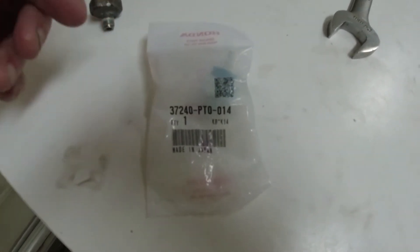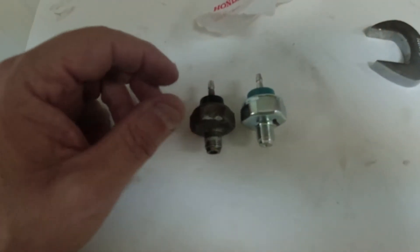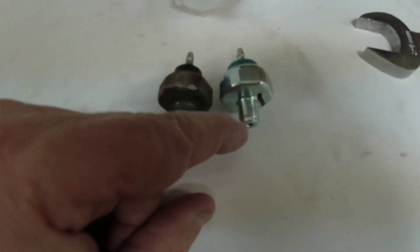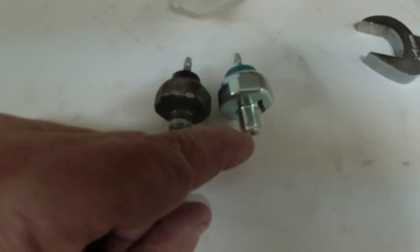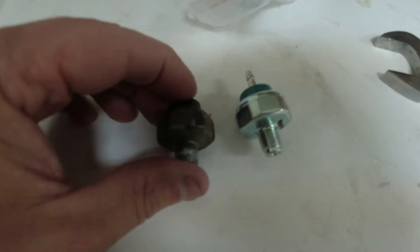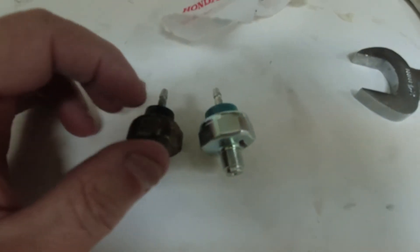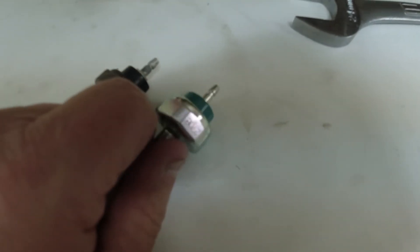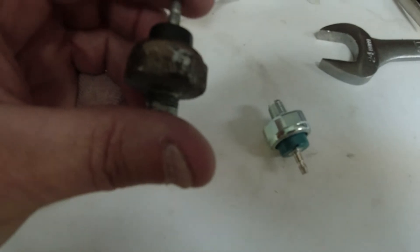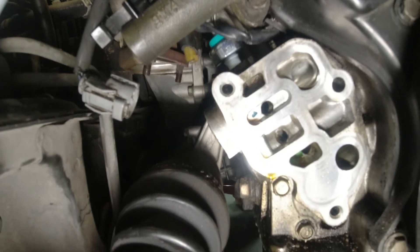I'll just put a little Teflon tape on here, thread it in, and see if the connector fits on. The thing I like about the genuine part as opposed to an AutoZone or O'Reilly's part is the tip here — it's not threaded all the way to the end like the Duralast part was. So this fits in the hole and then just starts threading; it's so much easier to put in. I struggled getting that Duralast one to catch the first thread — what a pain. This is a whole lot better design. You can see right on here it says Tech — T-E-C. The old one had a D on it, the Denso D. Attack the connector and it snaps on there very tight, which is good.